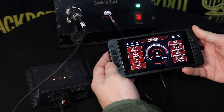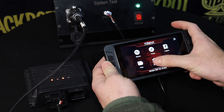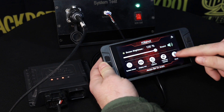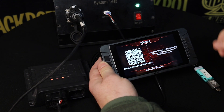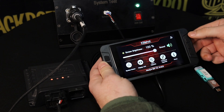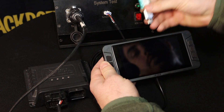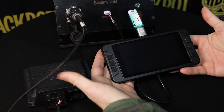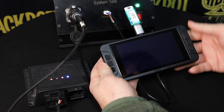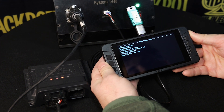We've got our 5-inch handheld plugged in along with the matching ECU. I'm just going to check and show you guys the current version — you can see it is 2.02 and we're going to be updating it to 2.07, which is the latest at the time of this video. So we're going to start with the key switch off, plug our USB into the top of the handheld, make sure it's in there all the way, then just turn the key on. You're going to see it come up with the update — everything scanned successfully, and now it's going to start loading the 2.07 software.